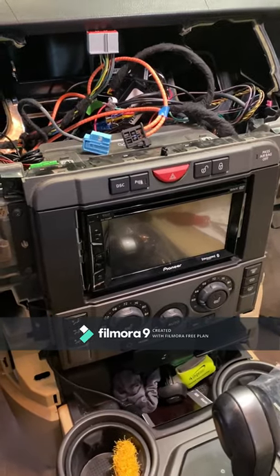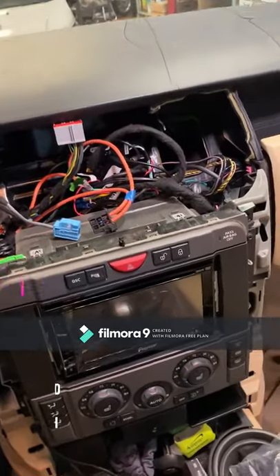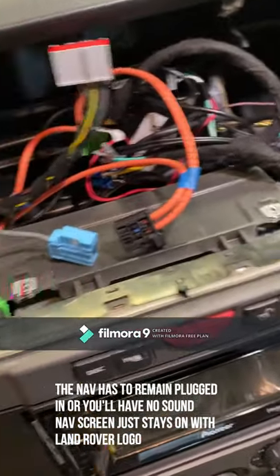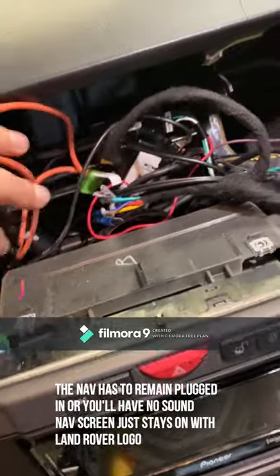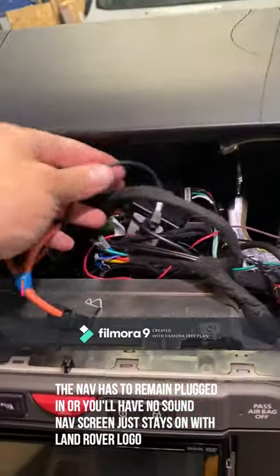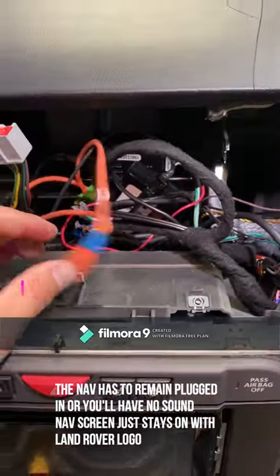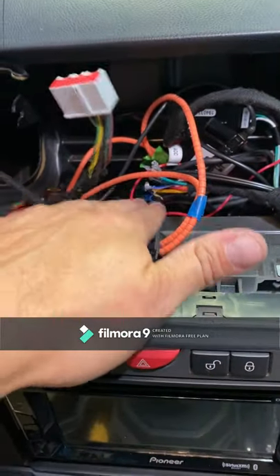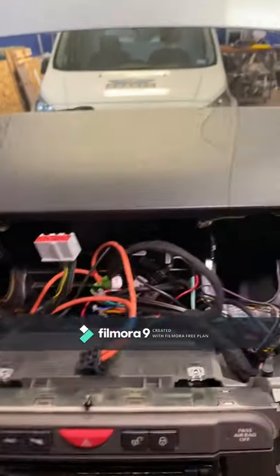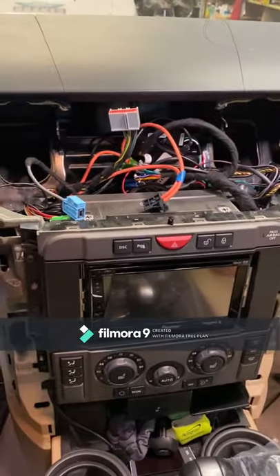In this part of the video I have removed the upper navigation system to pull wires out and route them to the necessary locations so they're not all just jammed up back here. Here are all the boxes and the radio converter. Everything is kind of all over the place — you really need to push them down below the AC vents and tuck some behind here as well in order to make sure everything fits and the AC vents go back in. They bevel up a bit so you do have a little room.